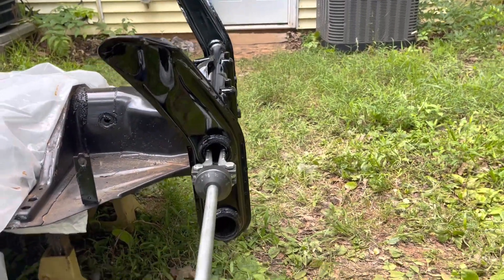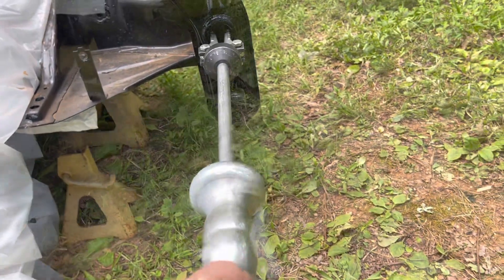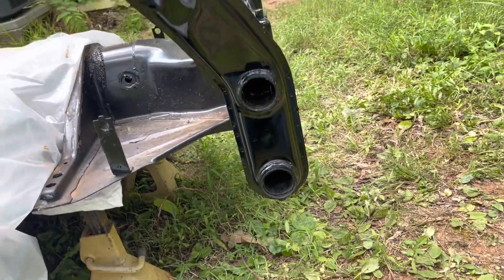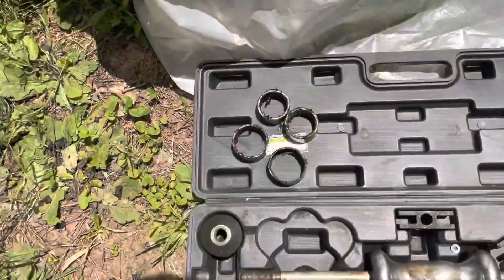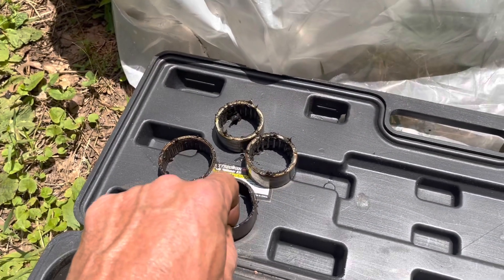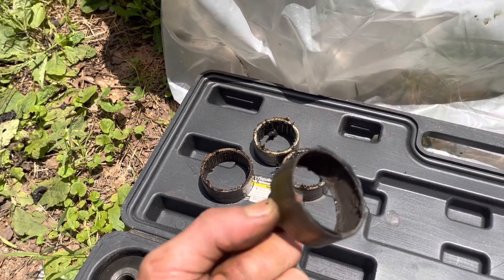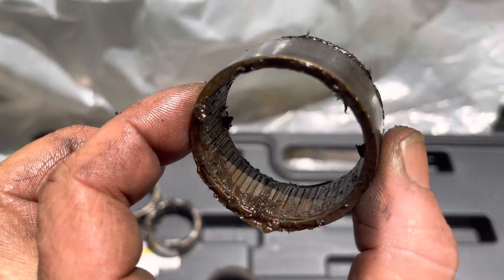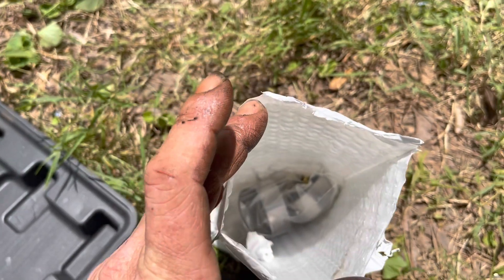Now I've got the beam mounted onto the chassis. I'm going to replace these front bearings. I've got a two-jaw puller mounted to my slide hammer and they slide right out. There's the bearing removed out of the top one. Now I'm going to pull the bottom one on this side and the other side. Once I pull those out, I'm going to replace the bearings and we'll go from there. Now you can see I got all four bearings out, but the one that had the spring steel running between the two ball joint arms — the side that was broken — the needle bearings are all missing. There's not a single bearing inside of it. Here are my four new bearings, getting ready to set those in and grease them.